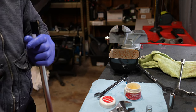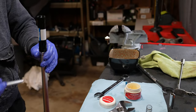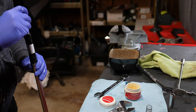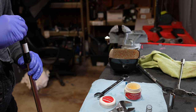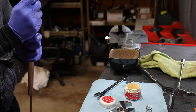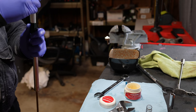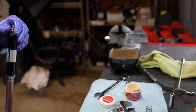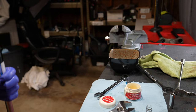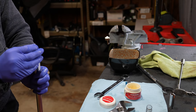Make sure the rebound rod is fully extended, then take the compression needle and push it through. Be super careful because there are a couple of check balls in the upper portion — do not lose the little parts. Recheck the IFP height to make sure nothing moved. Once the needle is set it will go into the base valve and you can turn it and hear it click like you're making an adjustment. There's a bleeder hole inside the IFP to be aware of.